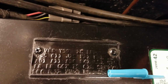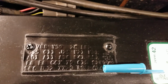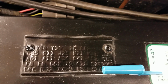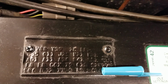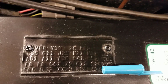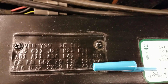Got the VIN number here partially conveniently covered up, so we're not showing that online. But basically it talks about the aerodynamic nose, the wider windshield moldings, flush mount grille, the standard 11-inch drum brakes. This car actually has the upgraded power front disc, which was a B code. B41 I think is on there. Yes it is. And B51 was front disc package.